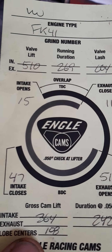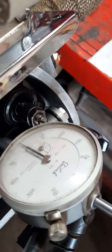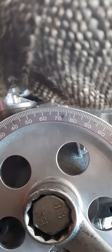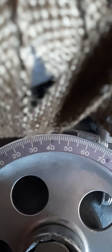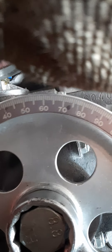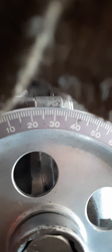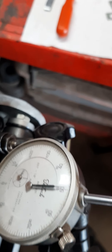What I'm trying to do is see if the pattern all lays out the way it is on the chart in the engine, based on the position of the valve at 50-thou lift, and the position of the timing reference mark on the degree wheel on the front pulley. Right at top center — it's kind of hard to see where top center is because it's tucked up under there. There's our centerline mark. I'm going to rotate this around to where the valve would start to open — let's see if it opens before top dead center, just like the pattern says. When I get it to that parting line, there's our 15 degrees before top dead center.